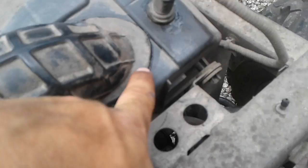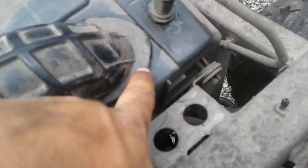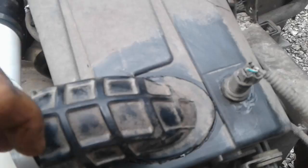We also pulled all these boots out and sealed them up. Honda didn't even have them put in there right — this boot was folded, so major leak there. Got to yank the boot out, rip off all the Honda goop, and then put good ultra black sealer.